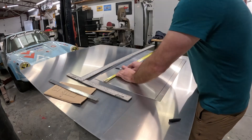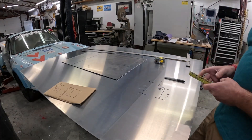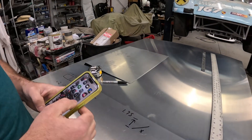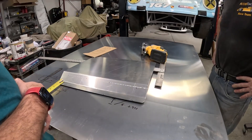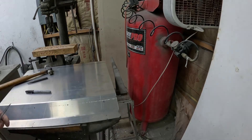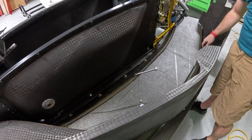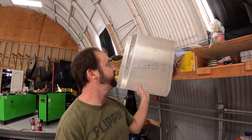I should add another disclaimer: I'm making this a bit more complicated than it has to be, mainly because I'm hoping to mount the radiator and oil cooler to the top of my car rather than just bolting it down on top of my tunnels. That way, if I have a problem with the tunnels or side pods, I should be able to remove them without having to mess with the oil cooler or radiator. What I'm trying to do is use the flange that the floor bolts to as the mounting surface for trays that will hold up my oil cooler and radiator. Even though we're making this out of stiff enough aluminum, there's still a chance I'll need to support the outer edge — hopefully keeping this a static solution without having to drill holes through my new carbon tunnel.